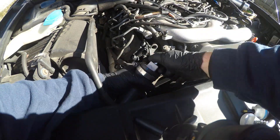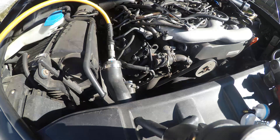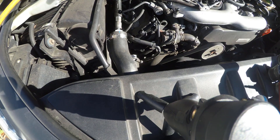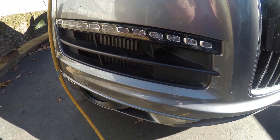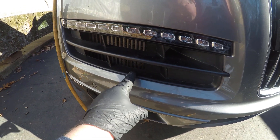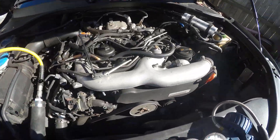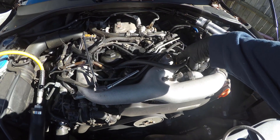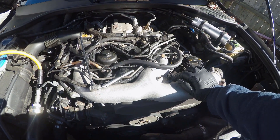Put the airline fitting tester in there and plug in our air hose. You should hear a little bit of air noise just from the air rushing into the system, but you shouldn't hear any major hissing noises like we did on the Q5. The charge coolers and intercoolers down here on the sides have a bad tendency to leak at the O-rings where the hoses go into the bottom. The driver's side tends to be pretty bad about it with the lower O-ring. Looking at the top, the intake manifold was leaking on the lower side — the plastic one. The gasket was leaking on the bottom. I had to take this all off and clean it out so it would seal up properly.